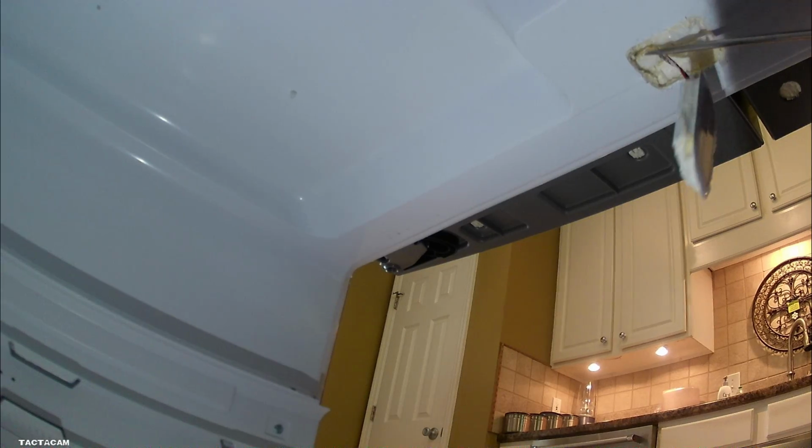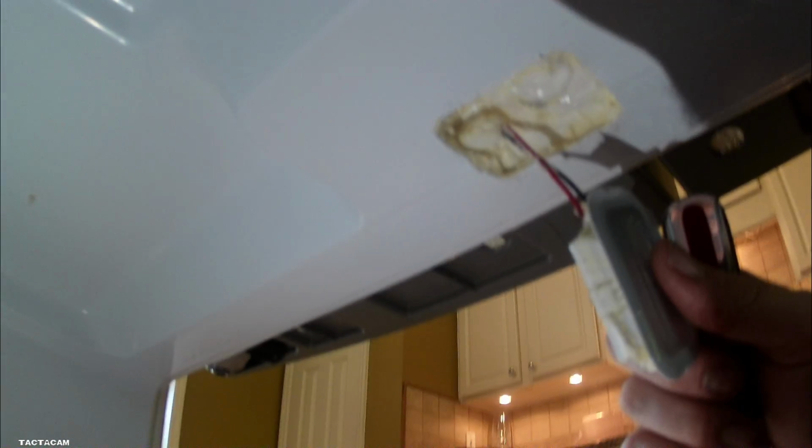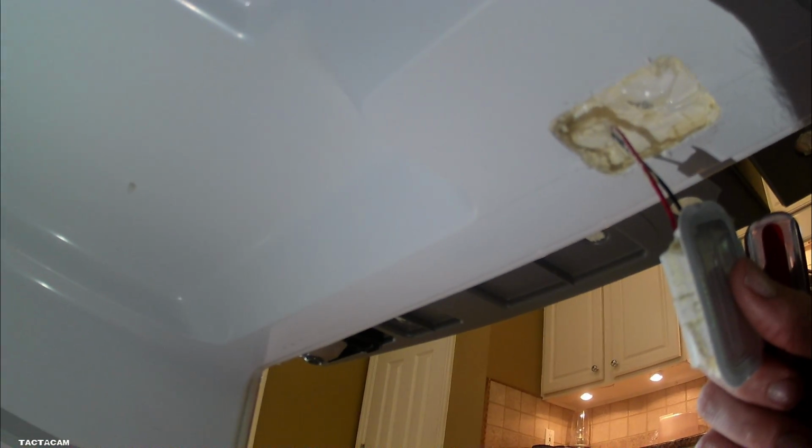Tons of it on the inside, and it probably took me 30-40 minutes to maybe get that thing out. I had to get the freezer drawer out and pretty much get underneath it and work at it, because the way I was doing it, which is normally how I usually do it, it just wasn't easy. But the connection to get that light out, I had to dig it out as well, and there's a little tab that you want to push in to get that connection out. And again, go back to one of those other lights up top to actually see how to get it off, if you guys have a bunch of insulation on it just like this one. But it took me a while to get it out.